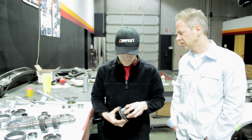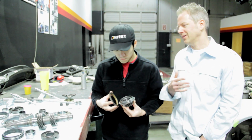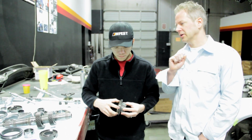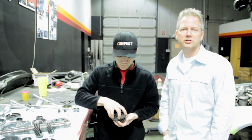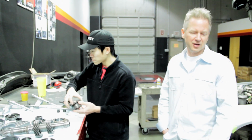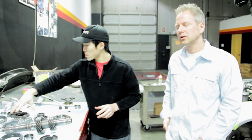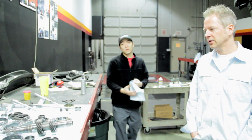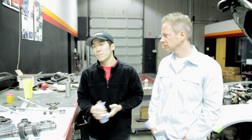And when you're racing, what I've noticed, at least in our race car, is the 2 to 3 shift. Normally I don't ever get into second gear, but if we do get into second gear and we hammer it into third, a lot of you E46 M3 owners probably notice no matter how hard you press that clutch in, you're still going to grind third gear if you do it quick. So that's definitely a synchro we're going to be replacing in the HPF car. Yeah, and a lot of times these synchros go out from nobody's fault.